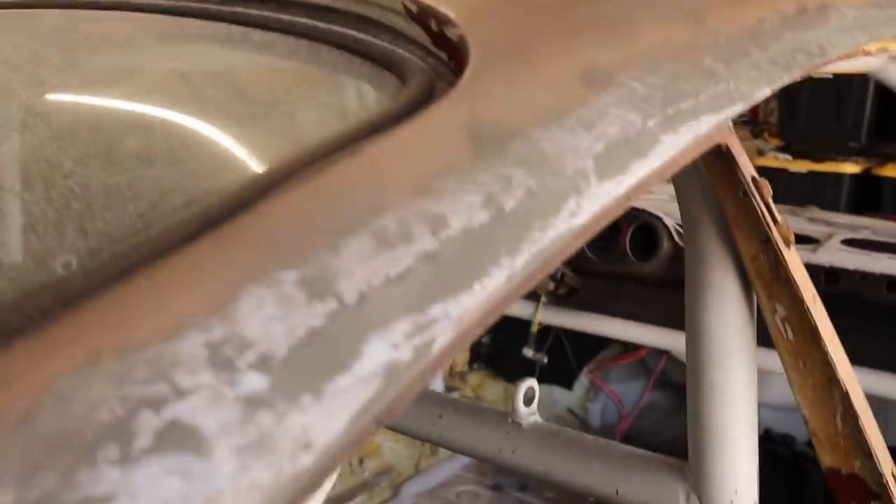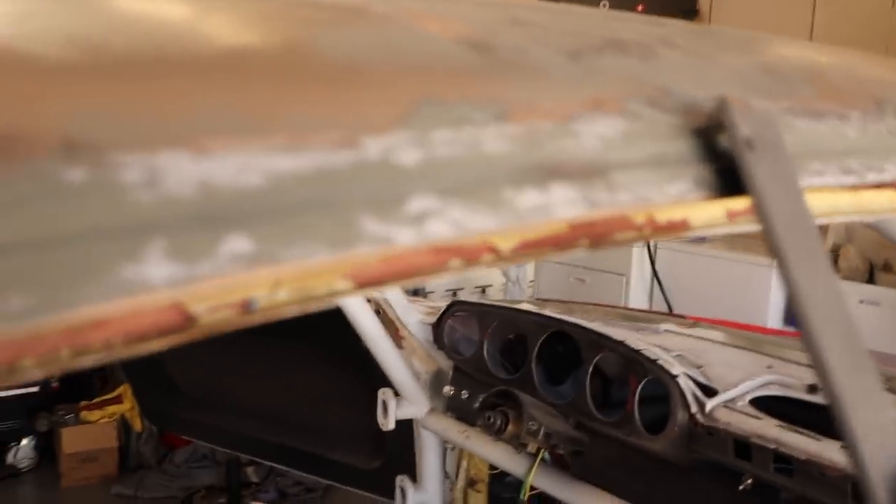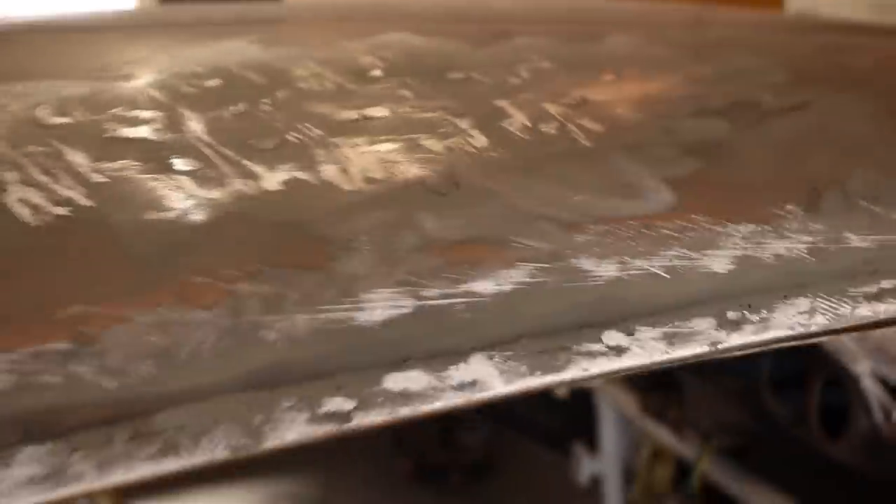As you can see, I am really close with these drip rails. I have ground them, welded, ground them, welded, then used these body files — the flat one — to go across. You can see there's a bit of a low spot. Once I've ground this way you can see the low spots. I'm going to use that fiberglass technique from Bad Chad to fill this area in. I've also filled around 20 holes here — you can sort of see the weld marks.